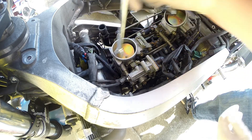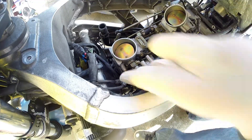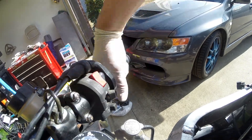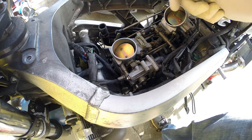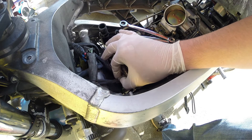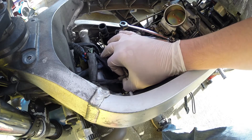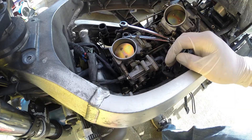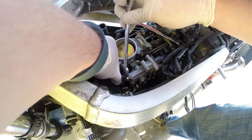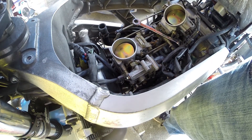I've got the top cable moved out of the way and I'm going to adjust the lower cable. You've got to hold the grip in the closed position and adjust until you get about 1mm of play. There's some play there — just tighten this down. We've got it adjusted for play, so tighten down the lock nut. Got a little bit of play.